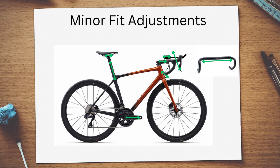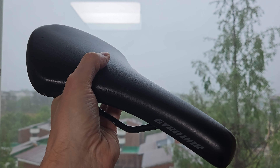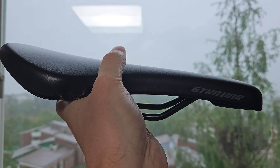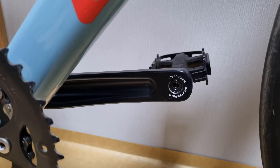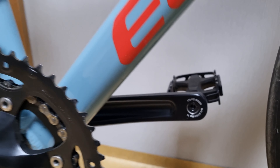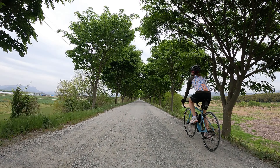Fit tuning and problem solving come next. Setting saddle height, angle, and setback are the best starting points, with other touchpoint characteristics determined afterward. This often means adjusting or swapping saddles, stems, handlebars, and sometimes even crank length. For my brother, the stock saddle desperately needed to be replaced — pressure from it didn't allow forward hip rotation and forced a bowed lower back. My wife's bike also needed a floppy saddle replaced; I flipped the stem, rotated the handlebars, and adjusted the controls to be higher and closer. Crank length and handlebar width were well out of line, causing hip tightness and splayed-out wrists.